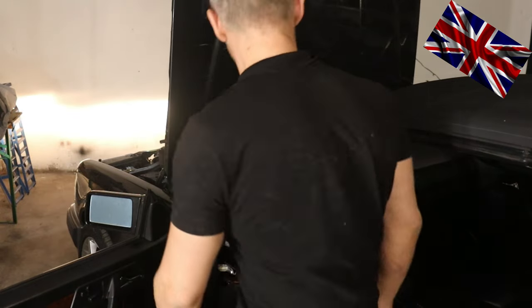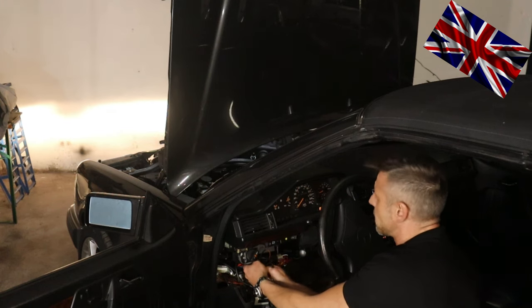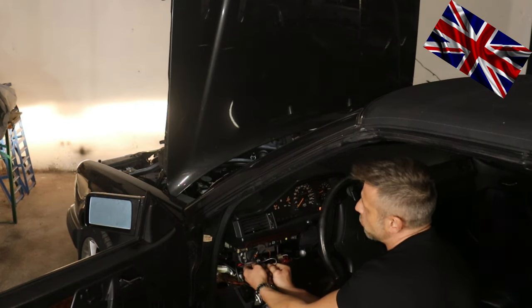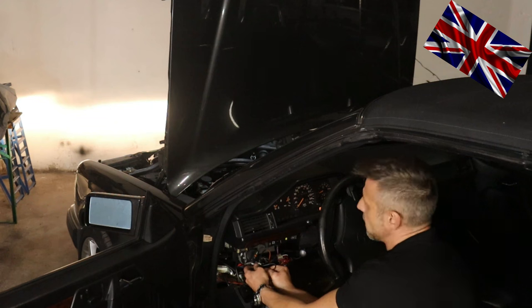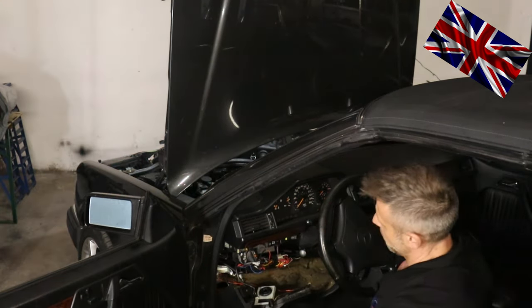I now unplug the vacuum line from the left port and the light beam is getting shorter. If I reconnect the line, the beam is getting longer. What did we achieve? Found culprit — a broken control switch, which was probably not airtight anymore.